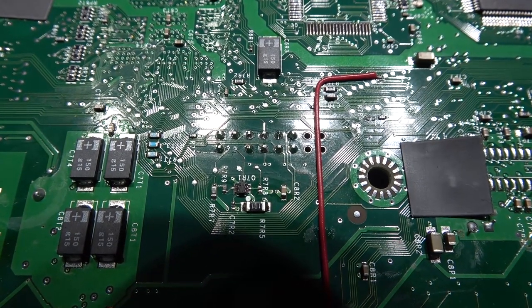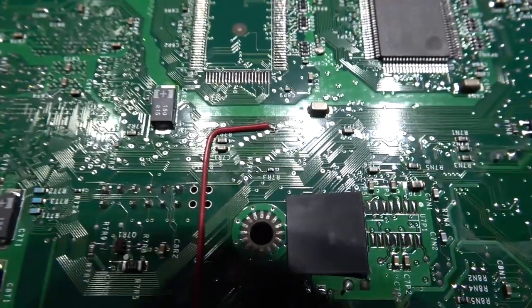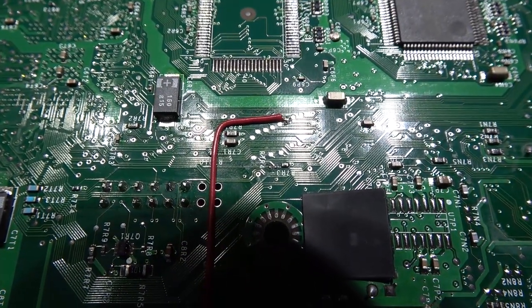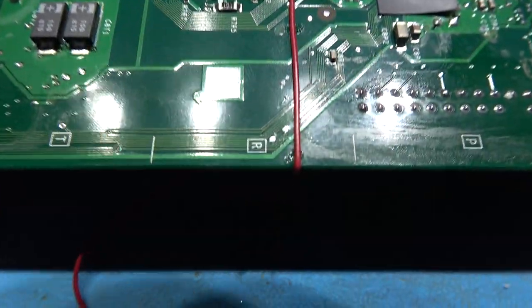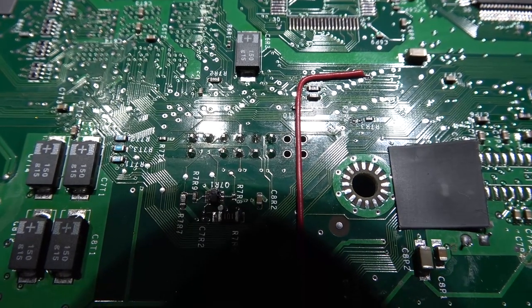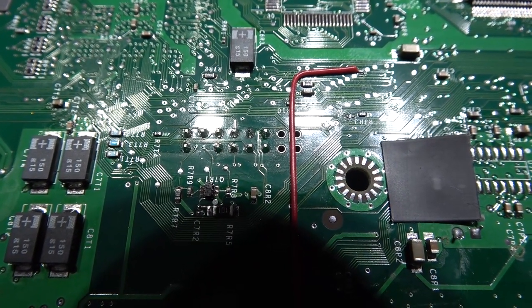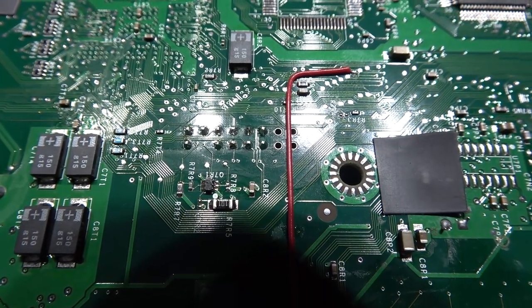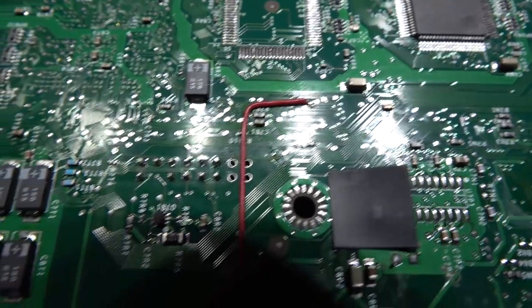As you can see, the pin header is soldered into the LPC port. I've also taken the opportunity to wire in the DO signal I need for the chip. That will go all the way to the other side of the board. Now you can get your DO signal from the top side of the board, but you're soldering to a really tiny via. It's better and easier just to get it from the underside of the board on a version 1.